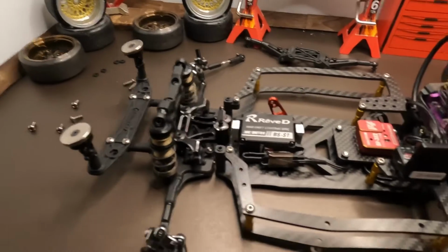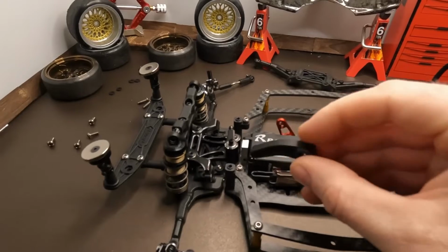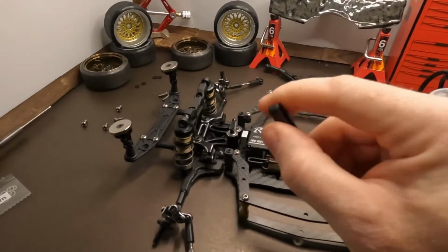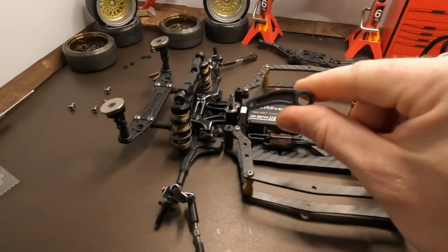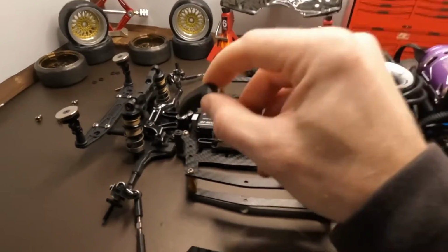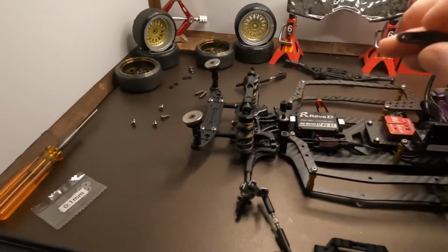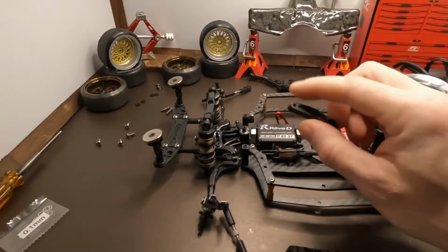So I guess one of the benefits of going to aluminum over plastic, I know some people were asking when I put a photo up, but the plastic, you know, it's just a softer material than aluminum, so it's gonna flex, and it probably could save your steering if you hit a wall real hard. It's gonna forgive more. Lighter, that is one thing I did not do, is weigh the two to compare them. But your aluminum is going to be more rigid, so it probably will give you a more direct feel. Not like these cars are heavy enough to be bending these under steering force.